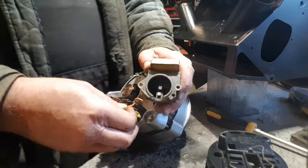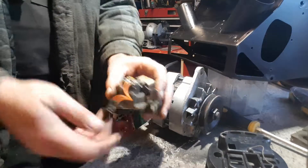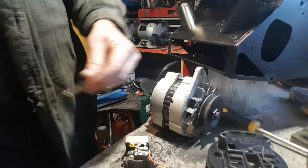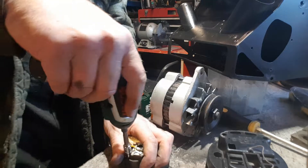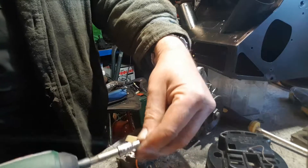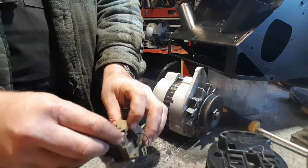If I wanted to go any further than this, I would disconnect the whole pack from the back of the alternator. There's the alternator now without that part connected. On the top of the alternator, we might then consider undoing these four screws, and under there you'll find the springs and the brushes. It's up to you whether you go that far. Let me take one off just to show you what it is that you're looking at. So, there's one. When you take these things apart, just make a mental note of where the wires go — the brushes need to make a circuit, so the yellow wire and the orange wire go to the same brush.